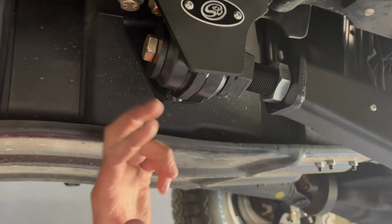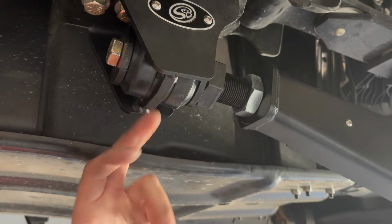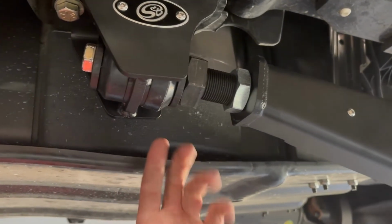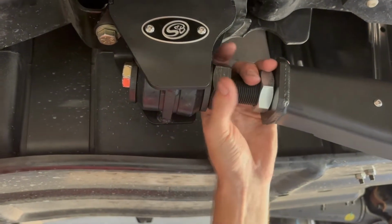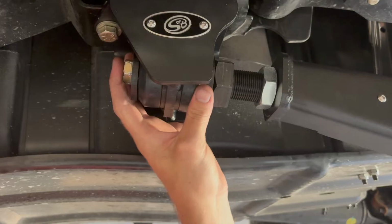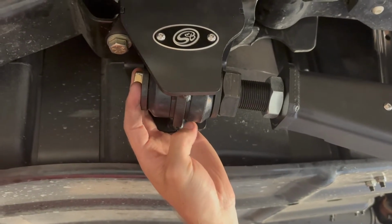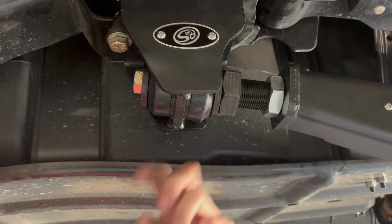So super important, you have your bolt, big black flange washer, a bushing, there's an O-ring in here, another O-ring, bushing, big black washer, and then that bushing through the middle, the aluminum tube, that's going to be the compression limiter. So it's important that that's how you assemble this bushing stack, or you're either going to rip the bushings up in half real quick if the compression limiters aren't in there, or this washer's not here, this bolt's going to chew the face of this up.